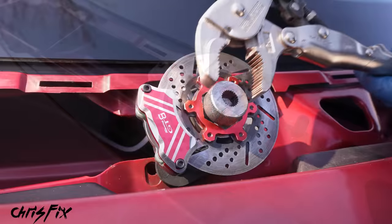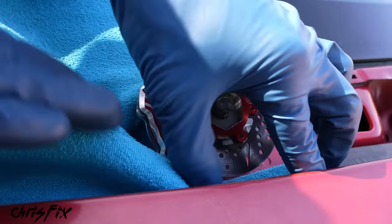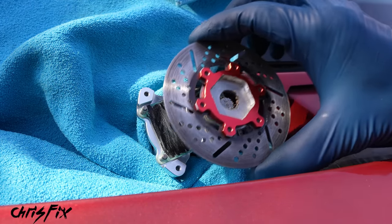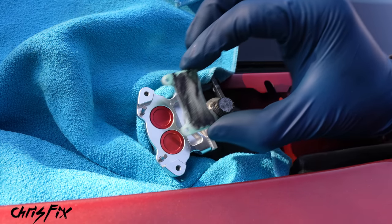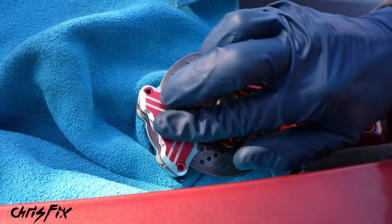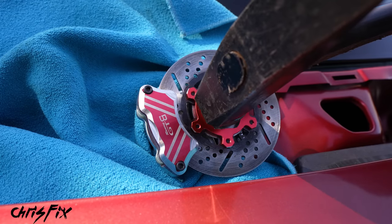With the driver's side completely done, let's move to the passenger side. Clamp onto the wiper sprocket and pop it off, then — almost forgot the towel! Without the towel something would definitely have dropped. Now remove the bolts holding the caliper, remove the brake pad, the brake rotor, the two springs on the locator pins, and slide the other worn brake pad off. In with the new — get the springs back on the pins, rotor back on, second pad on, caliper hat on, hand-tighten both bolts, and torque down to spec. Finally, line up the wiper sprocket and carefully tap it in so the splines mesh.